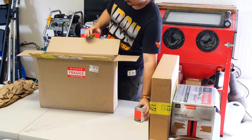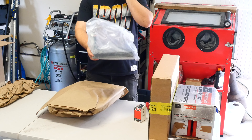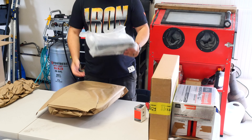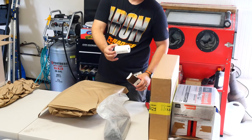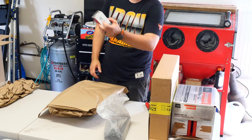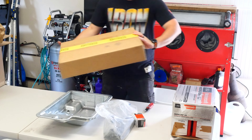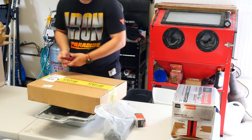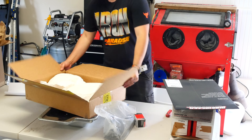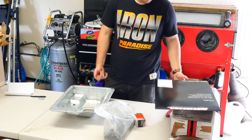So this is going to be everything we'll need, most likely. The first box has the updated filter — a lower micron, better flowing filter to help keep it clean. This is the toilet paper roll filter, an OEM Motorcraft filter for the transmission on the front of the truck. That is the updated transmission pan for the 5R110. And then this last box, since it is so light, is our gasket — a Lube Locker gasket for the pan. These fit the E4OD and 5R110 because they're all the same pan style.